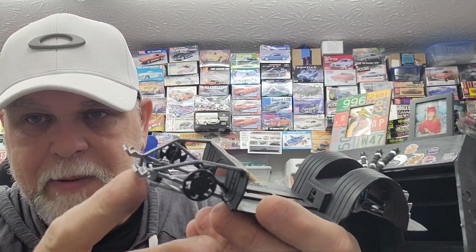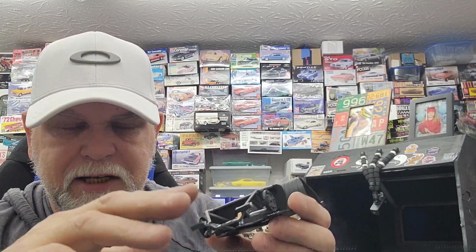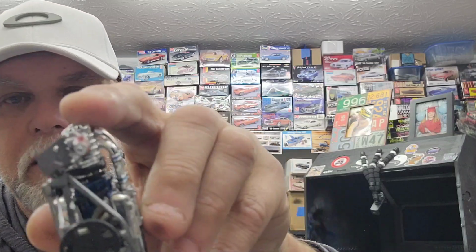I did break this off, but I did get it back on, and we're gonna have to shave the back of this off a little bit to allow those radiators to sit back just a little bit more, because the engine, it's not crooked, and these aren't crooked, but this side's lower than what this side is, so it's probably in the blower assembly itself. We got our blower support on. We just got to put it in here, and then we will come down through there and mark and cut off the excess and then repaint that to match, and then we can get it all glued in.